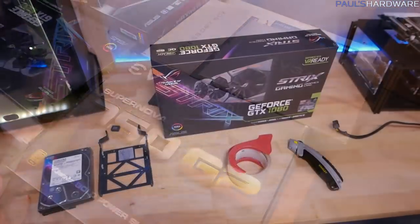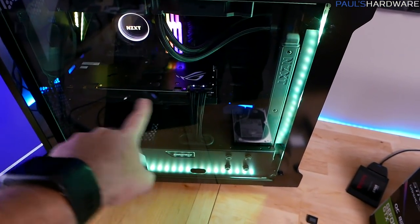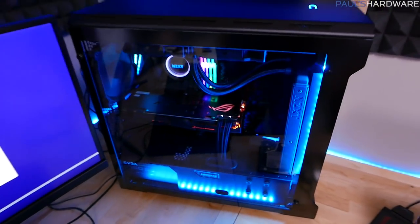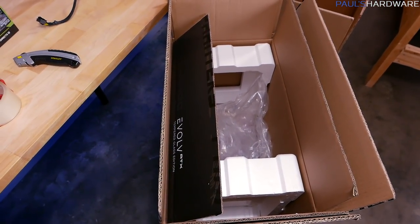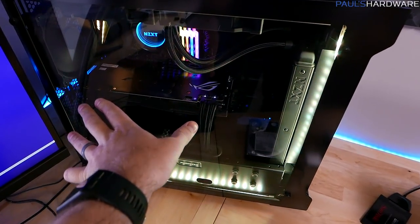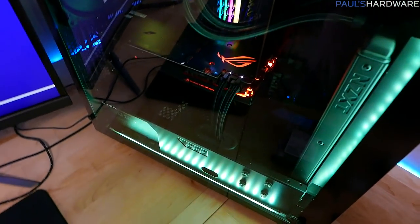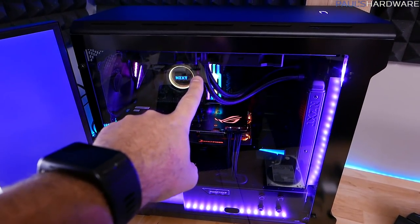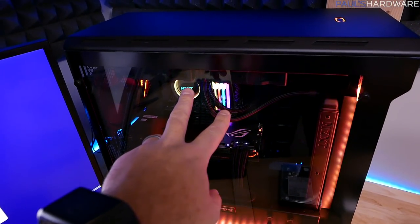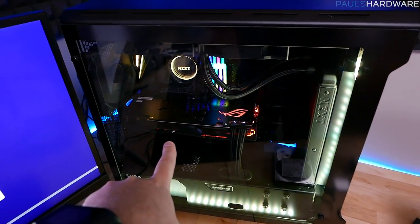Once Windows is installed and activated, I'll pull the graphics card out — you never want to ship a GPU inside a system. You have to assume the box will be tossed around and land on any side, creating torque and impacts that a hanging graphics card may not withstand. You should also tie extra cables off to the side so they can't bang around. Closed-loop liquid coolers are actually a big advantage here — the radiator is more secure and there's no heavy weight on the CPU block like with an air cooler, which is why boutique builders like CyberPower prefer them for shipping.